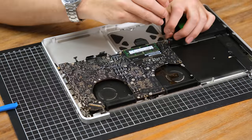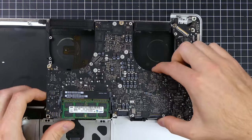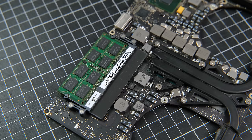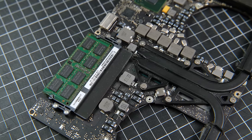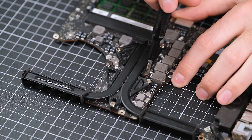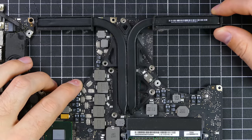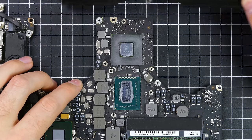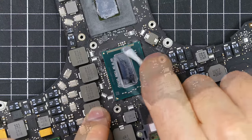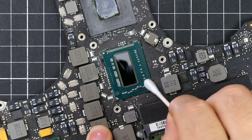The board isn't all that dusty, especially considering this was previously run without the back casing on at all. If you've successfully removed every screw and the heatsink hasn't melted to the keyboard backlight, it should come out without much force. The underside of the board is where you'll find the heatsink for both the CPU and graphics processor — they share the same one and aren't known for running all that cool, hence why a fresh application of thermal paste will give the cooling system its best possible chance. Upon inspection it does look as if it was repasted at some point — if it was original it would be far harder and more like dust than paste. To get the die surface absolutely spotless, a bit of isopropyl alcohol is recommended.